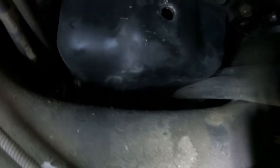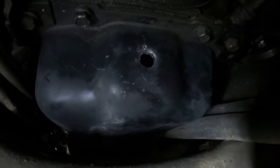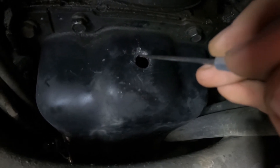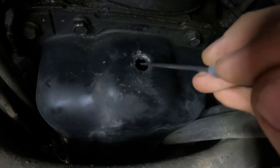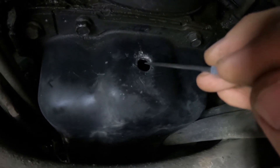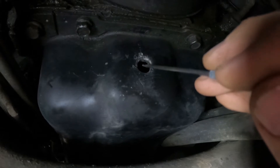Here's the hole I got made. The idea is you don't want to just drill a hole straight through it — you want to push the metal back into the oil pan so you've got enough meat there to put your threads into to hold your pipe fitting. You essentially want to make a mini tunnel there, because if you just cut a hole straight through it, you won't have anything to put your threads into.